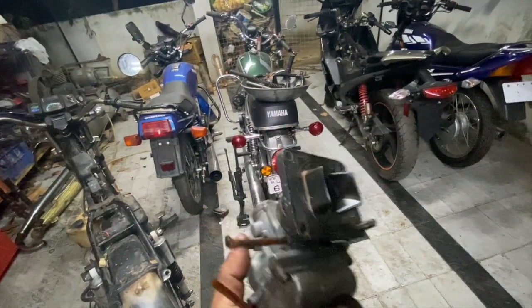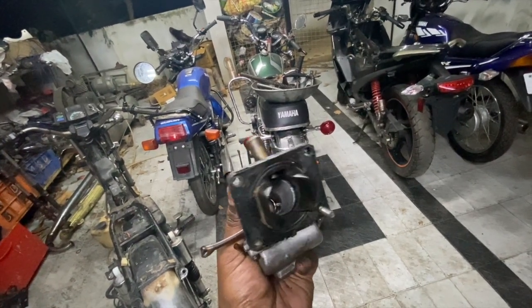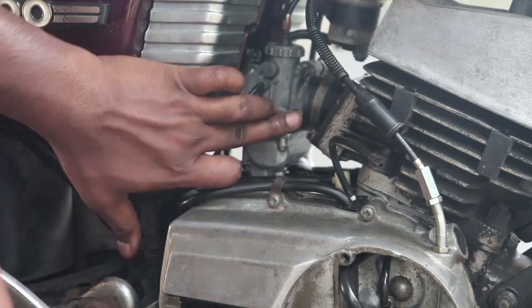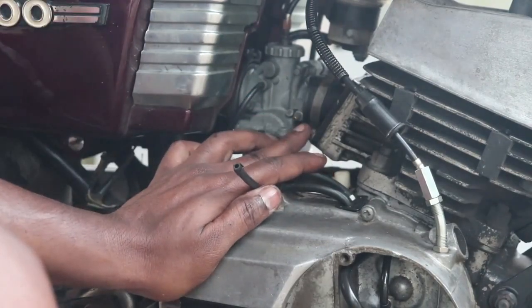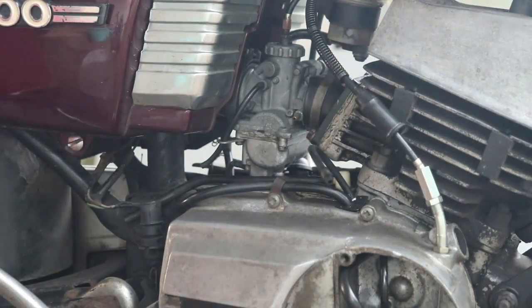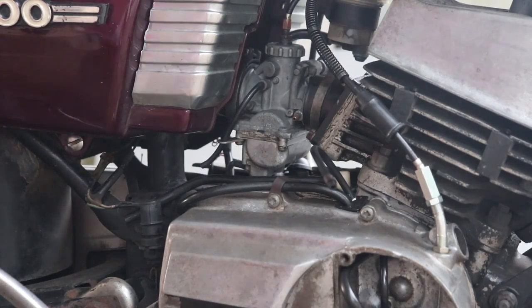If you have an oil pump, as you can see in this video, the oil injection happens after the carburetor slide, so the engine doesn't starve. Even if you're doing engine braking, oil is still being pumped into the manifold. For short stints of engine braking things won't go bad, but if you're going downhill and using engine braking, you'll definitely ruin your engine — a two-stroke is not meant to do engine braking. The oil pump also helps common people avoid doing the mathematics of calculating how much oil to add.